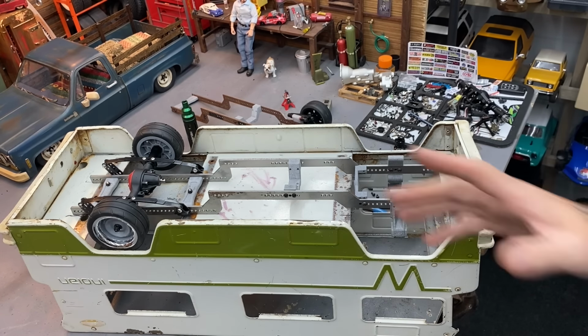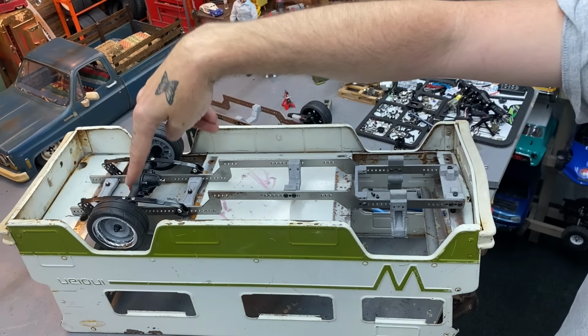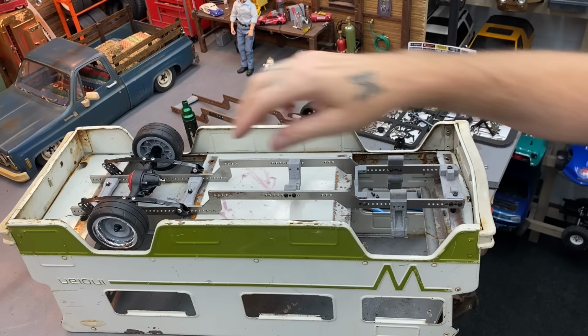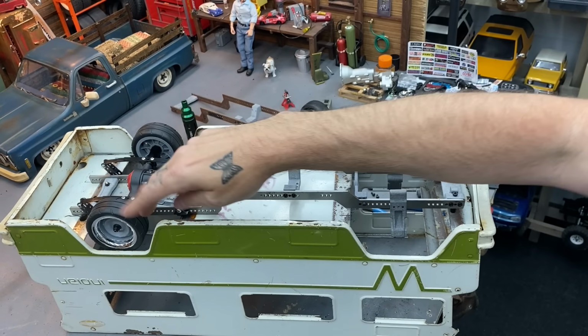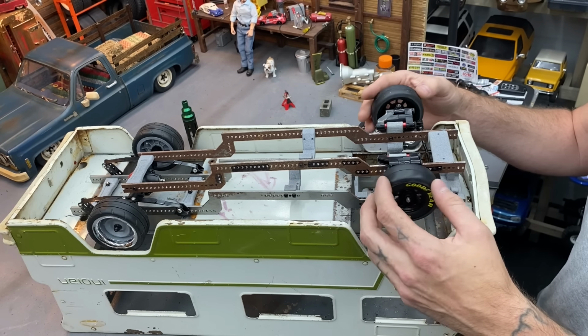I've got some parts. I've got a BRX 70 boom racing axle in here. It does clear with some 1.9s. Very tight, slightly narrower hexes, but it does work. These are just Traxxas rally wheels on Traxxas 1.9 tires. It looks like up front is going to require the Tamiya M06 or M series arms. That looks like it should have plenty of room.